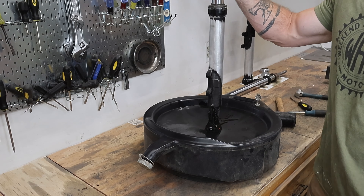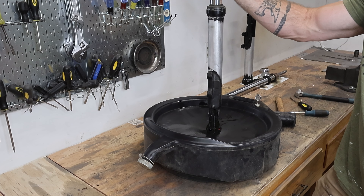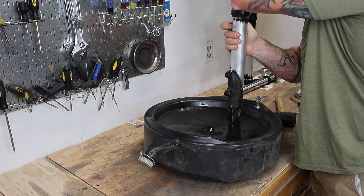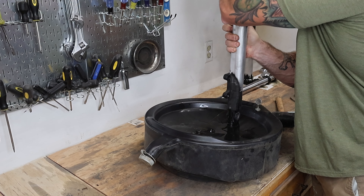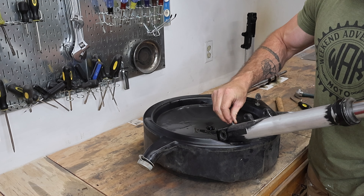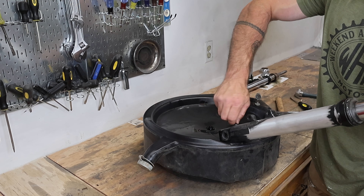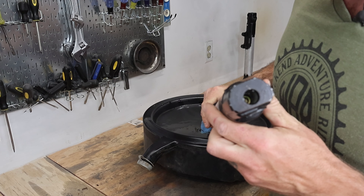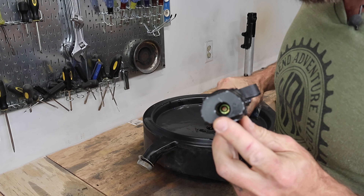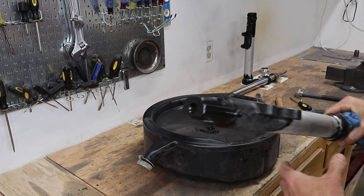When I put the fork up you can see the oil is starting to run out. We'll let that drain for a little bit and push down on the fork leg here — that's going to force some of the oil out. Then I'm going to put this back on. The reason I did that first is I want to limit some of the mess when I pull this plug out of the bottom. There is a hex head screw in the bottom; I have a six millimeter for that. So let's put this in the vise and pull that out.